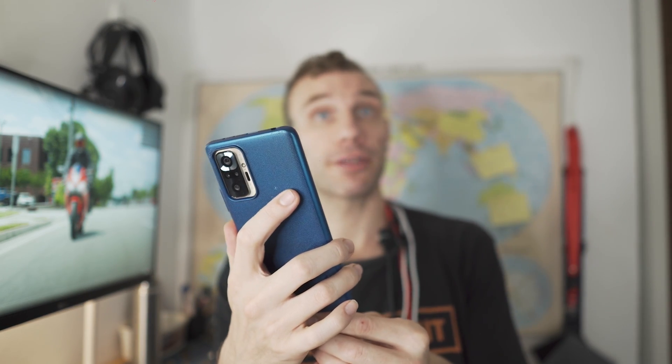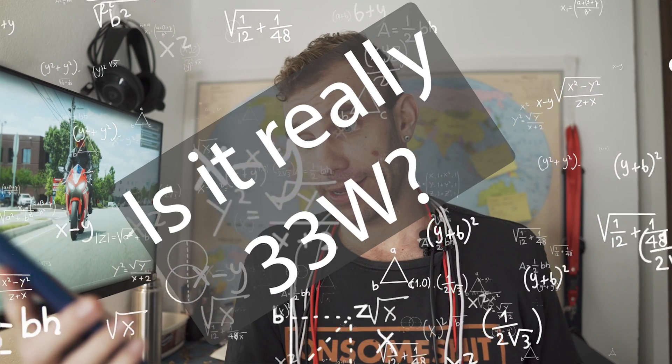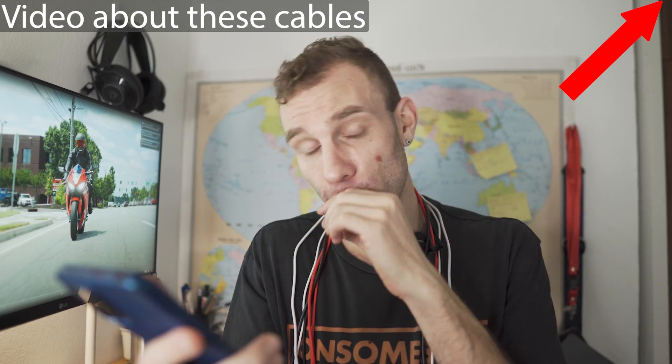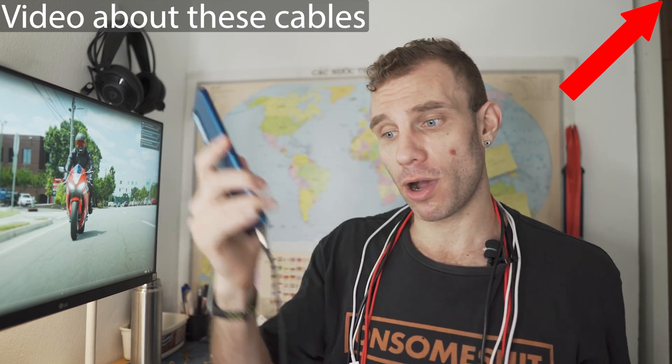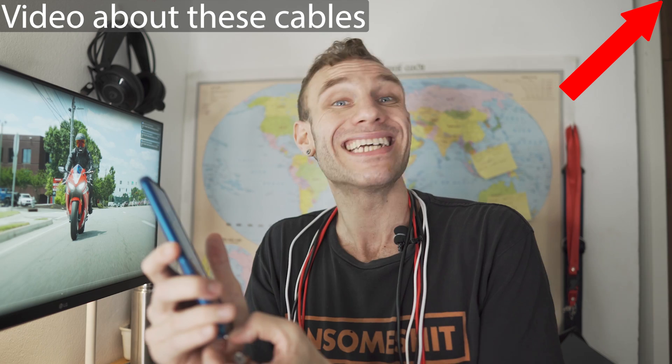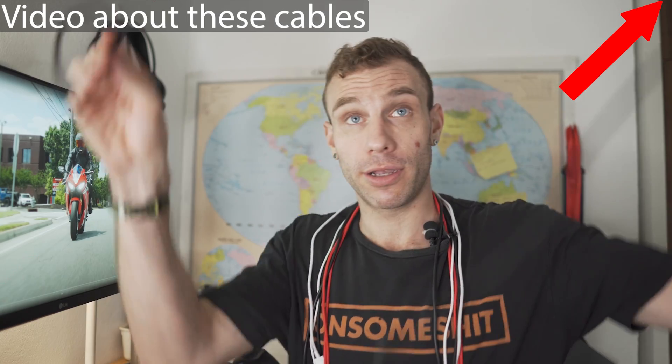We have Quick Charge. I've been able to get this to activate 33-watt charging, but it's been kind of inconsistent. Fast forward to the part in the video where I have it working — the 33-watt Mi Turbocharge — and it works fine. These ends, because they're magnetic, get kind of dirty, and if they're dirty you won't get the 33-watt charging. I had to clean this before filming. But yes, the Baseus cables work great and save your charging port. This is a win.